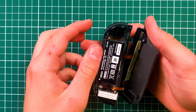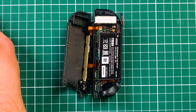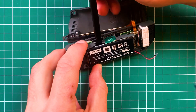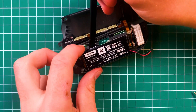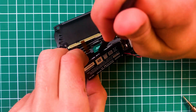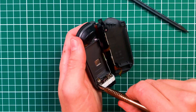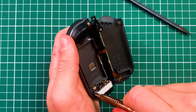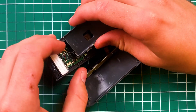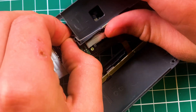We've disconnected the battery. The next thing is to take the battery out of the housing — it's glued in, so you're going to hear a little resistance, but don't be too afraid. If you've disconnected it, it should be fine. Now we're going to disconnect the battery housing from the PCB so we can see what's underneath. There's also a little antenna in here — just disconnect that.